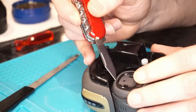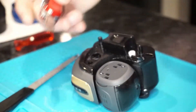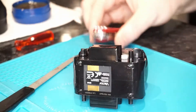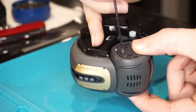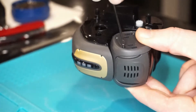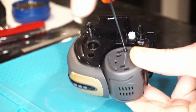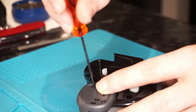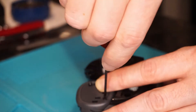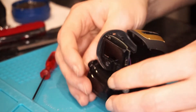Very similar to the Cosmo robot, though you've got a couple of extra little clips in there which help with the microphones for directional hearing, so it can turn to face a user giving it commands. The head assembly is held together with two screws on either side - you need to release both sets of screws. On the Anki Cosmo you can get away with just removing one side, but on this robot the screws go directly into the top vent, which houses the Wi-Fi and Bluetooth aerial and speaker, so you need to completely disassemble the head. Pinch the head together as you remove the screws to keep the assembly from breaking apart. It's not spring-loaded like the Cosmo, but you could still run into difficulties if the head is half hanging off - just keep your fingers pinched around it to save that little LED panel from falling off.